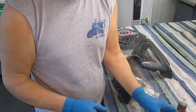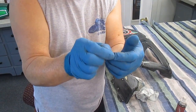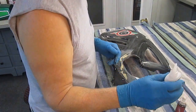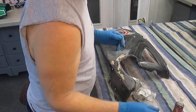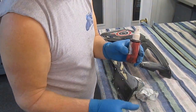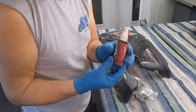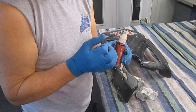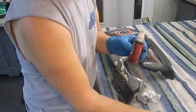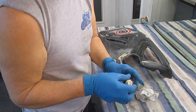Capillary means that when you have a surface with a microscopic one-molecule crack, it goes down in there and gets a good grip. By the way, when you want to make the glue accelerate and the joint set quicker, you can use kicker, but it's always best to use a minimum amount. If you put a big glob of thick on and hit it with kicker right away, it just turns to a chalky, popcorny kind of material.